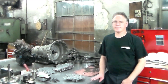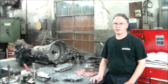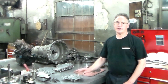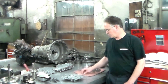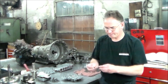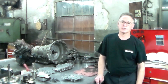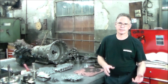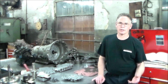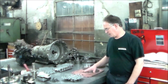All right, so back with you this morning. What I found to be a potential problem for the P0740 code is in the pump — you have the TCC accumulator. It's basically a little valve like this, I'm going to give you a close-up. That spring was broken. The TCC accumulator with a broken spring is going to give you apply and release concerns.